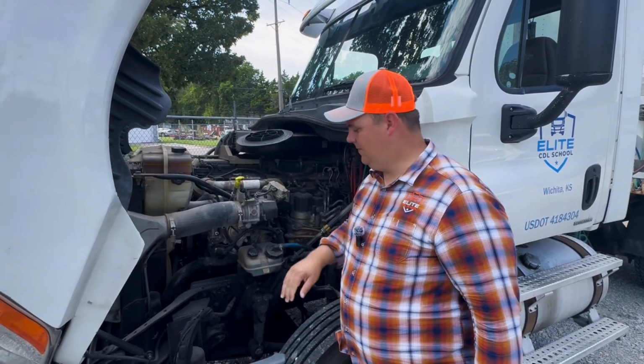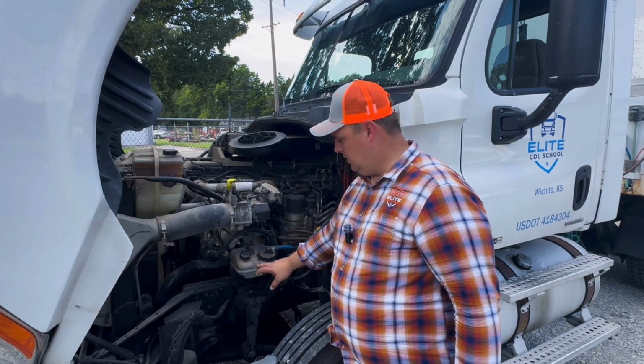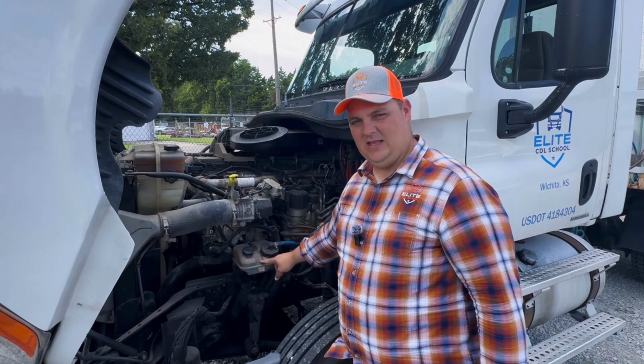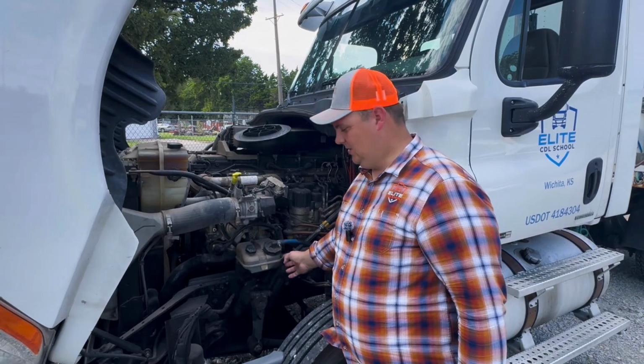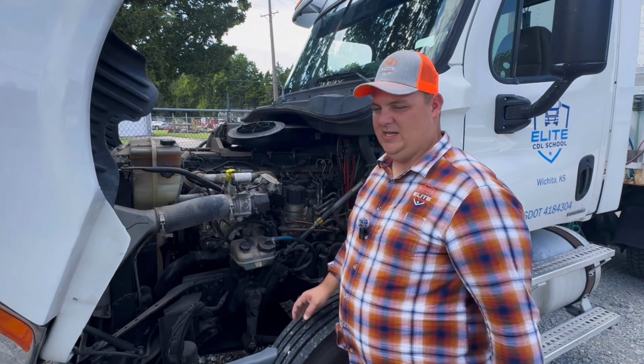Replace your dipstick. That brings you to your last fluid, which is your power steering fluid. You want to make sure that it's at the proper operating level. Make sure your reservoir box is properly mounted and secured and is not leaking any fluids. Once you've covered your 3 fluids, then you want to go into any leaks.